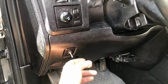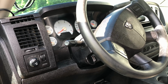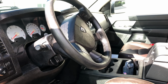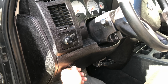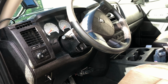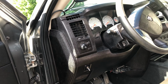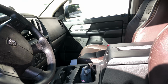This switch I put in for a backup camera for manual, so I can be going straight down the road and just hit this switch if I want to look behind me in case I want to see what's going on with the trailer or something, make sure I haven't lost something. So I can switch that on for the backup camera. It's also wired into the reverse lights, so if it's at night the reverse lights will be on, bypassed, even though the truck won't be in reverse.